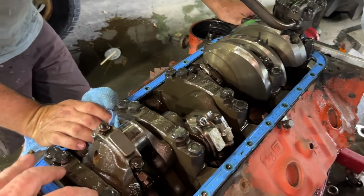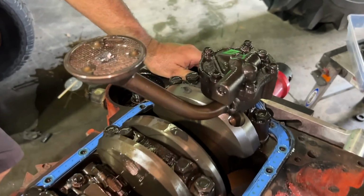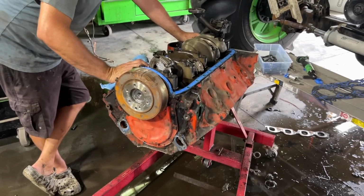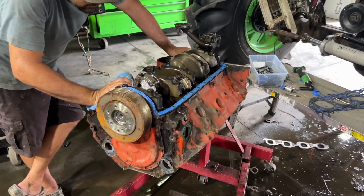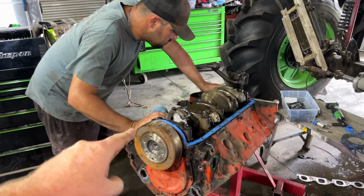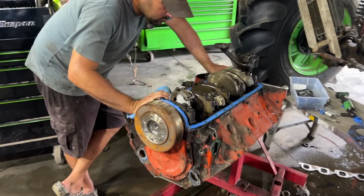I had one 454 before in my life. It was a 2-bolt. So, I don't know. Either way, we'll get this thing all freshened up. Next step is the machine shop. We'll get this thing done and have us probably a nice 468 to go with it in the machine shop and get that thing set up and ready to rip. So Ron Burgundy is coming back with a better engine, more power, and we're going to change the pulleys around and make that blower really do its job, get about 10 pounds of boost out of this thing.